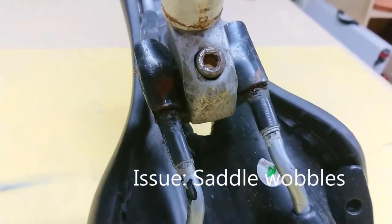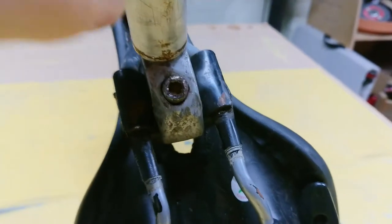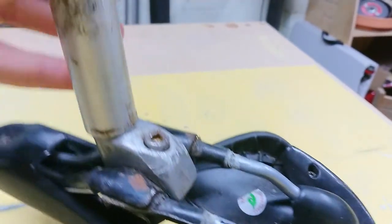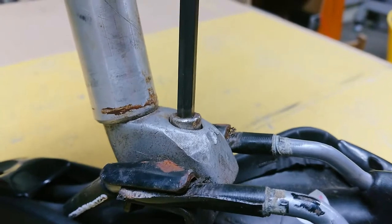The other thing to note is that the bolt here is damaged — it should be a 6mm Allen key, but it's quite damaged and we can't actually fit an Allen key into it. If I show you, what should fit quite nicely just can't get down.